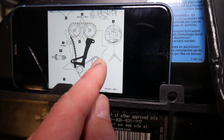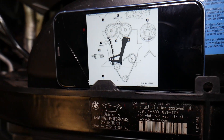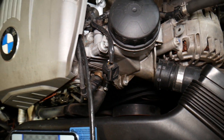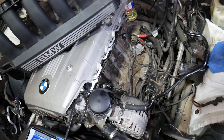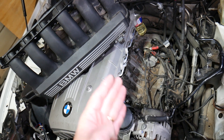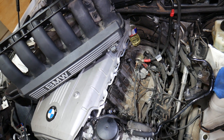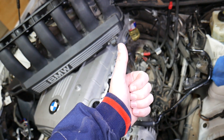This is the main timing chain on this engine. This timing chain is for the brake booster pump, and this is the oil pump with the balancer. There is a special holder tool required in order to remove and replace that pump without screwing up the timing. The tool will differ — a different one for N51 and N52 engines, and a different tool for N53 and N54. I'll try to post the links in the description below to the tools and new pump. Hopefully the video will be helpful — thank you for watching, please subscribe for more videos.